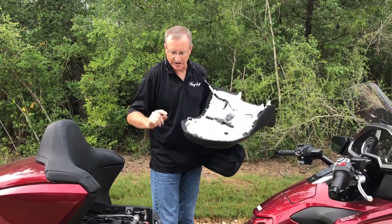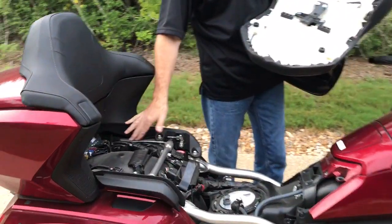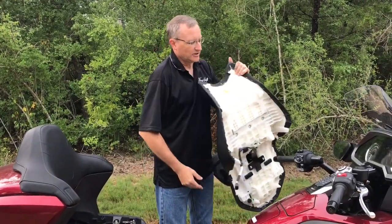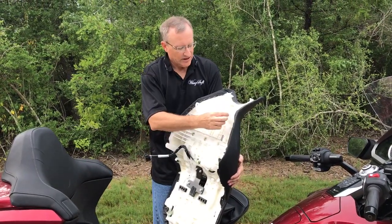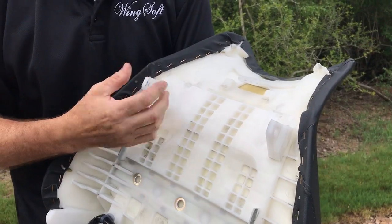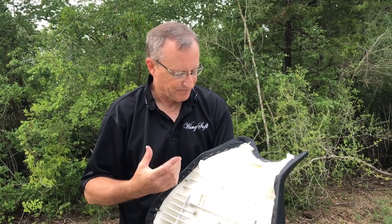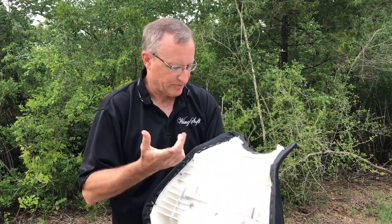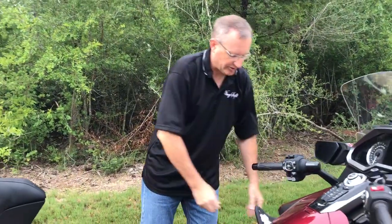To put it back on you do the same thing in reverse. What really helps a lot is to take some light oil — WD-40 or something like that — and put it on the rubber bushings and on this back frame rail, because you have to slide this rubber against that frame. It makes it easier to slide on and off once you have a little lube on there. One thing I want to make everyone aware of: from the factory you have two bushings that go in these holes, and mine are missing. They're not pressed-fit — they're just kind of set in there and come out pretty easily. I've already lost one, so just be very aware of those little bushings. You may even lose them putting the seat on.